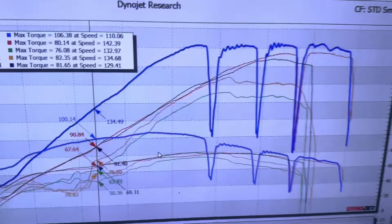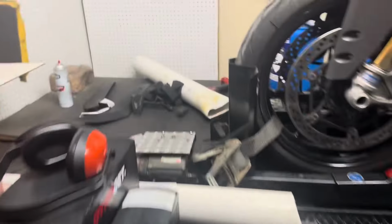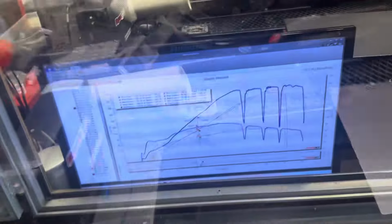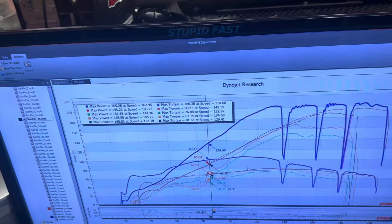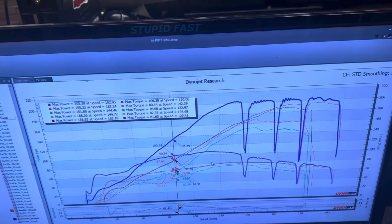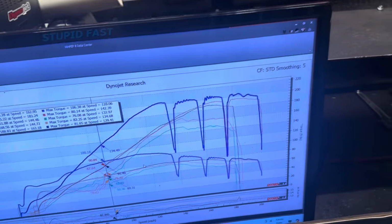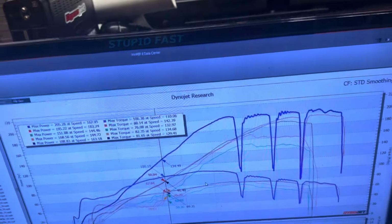It was not easy to work on. We ripped a whole bunch of stuff out of the airbox. That foam crap over there came out of the airbox, along with a huge pile of shavings, which my wife already cleaned up. But yeah, 205. I was expecting more out of it. I've had some other ones of those make a little bit higher number than that, but they had the European stacks in them. Apparently the American stacks are just like the regular CBR stacks,